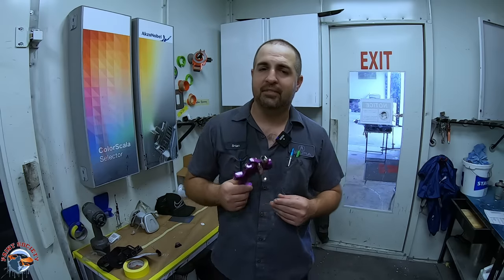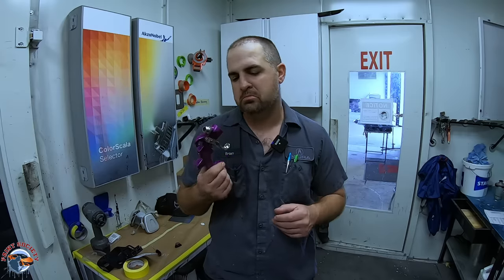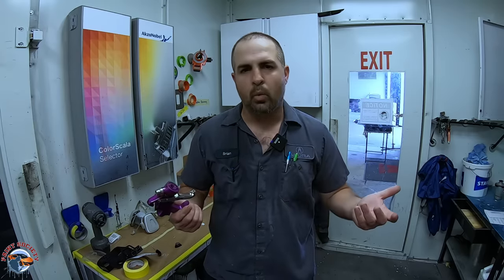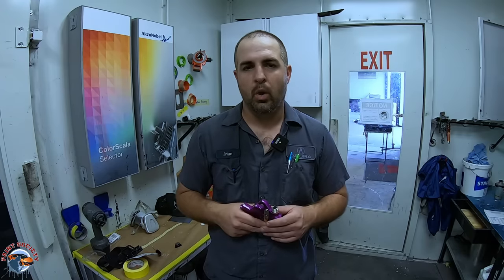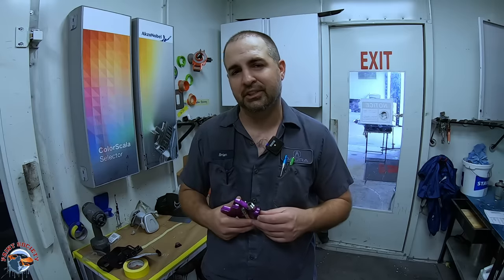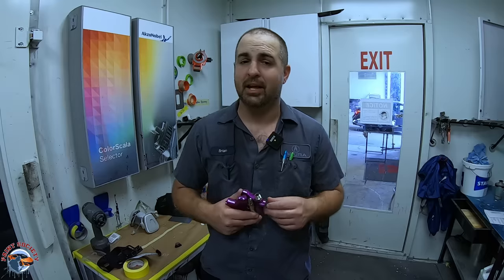And what I'm doing is I'm giving a 3.5 rating in regards to a beginner. Yeah, a professional like me can pick it up and work pretty hard and get a good finish. But why do I have to turn up the pressure over 35 pounds? Why do I have such minimal travel? Why does it feel like I'm going over the spot 3 or 4 times to get the finish? These are the types of things that can kind of discourage a newbie to painting. And it doesn't need to be like that.